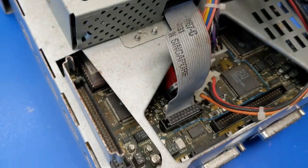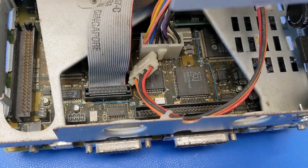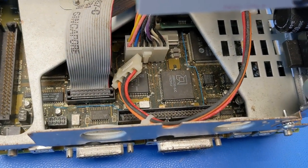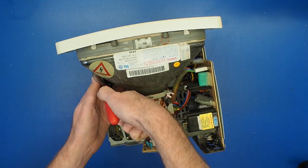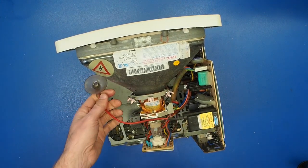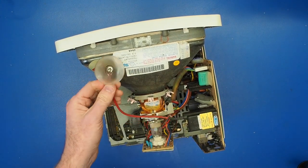The system is missing the original hard drive, but it was supplied with the original 50-pin SCSI cable, so we'll need to address that later on. Just a word of warning: don't disconnect the high voltage anode like we're doing here unless it's been safely discharged first.